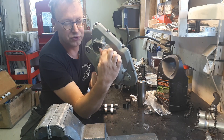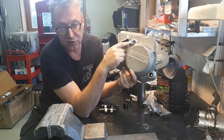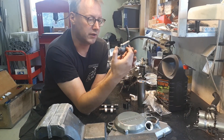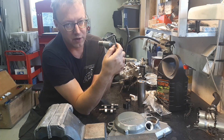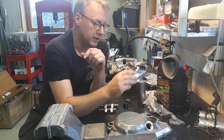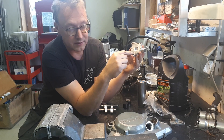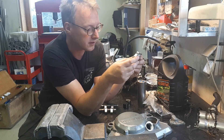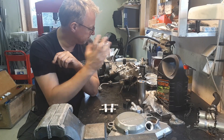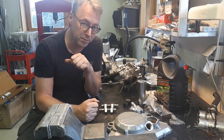I also had a water leakage from the transmission cover — the cover of the water impeller. I had it machined to shave off a couple of tenths to make the surface nice and flat, because the OEM impeller covers are weak and they get warped. So I had my machinist friend make new ones, this time with an o-ring seal so you can take them on and off without ever having to replace a gasket. That's a good improvement. Now I'm putting all this back together and on Tuesday there's a track day — so keep your fingers crossed please.